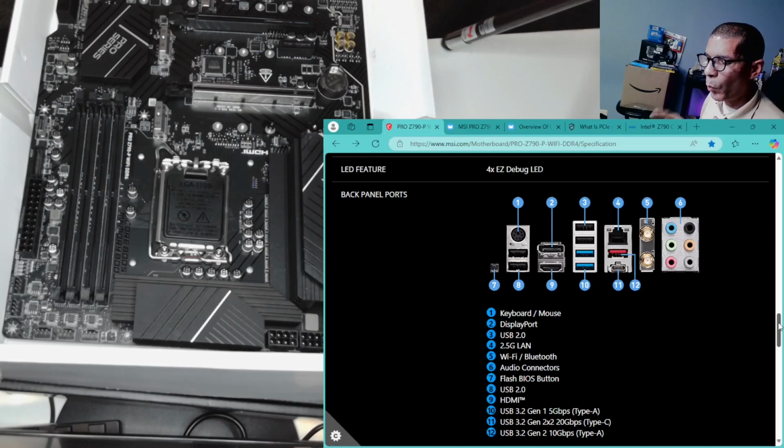The only time that you will probably have to do some kind of recovery like that is because you were trying to update it, and either you installed the wrong one, which kind of shouldn't allow you to anyway, or when you were trying to install it, something went wrong in the installation and you need to redo it. If you're upgrading it. But if your machine starts acting up and it was just fine, and there were no updates on the operating system, then it's hard to blame the BIOS.